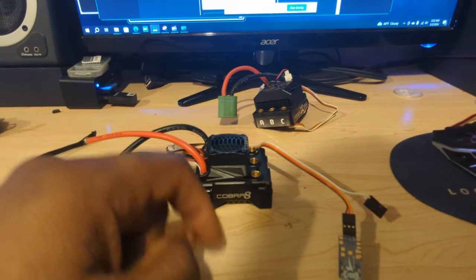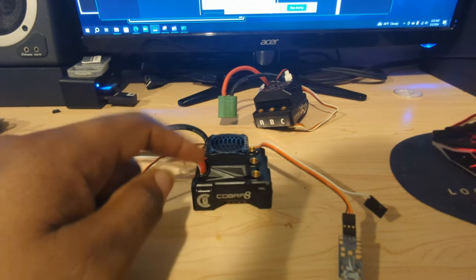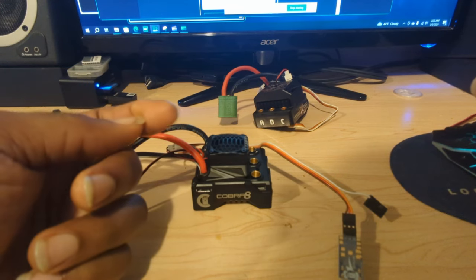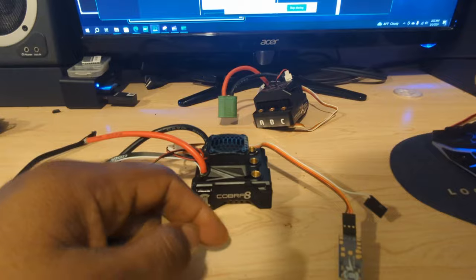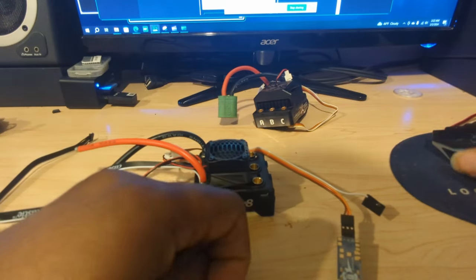If you do lap one and you're able to get, let's say, 0.6 Gs off of a turn, but then on lap two and lap three you're going slower or your G-forces are a lot lower, that's telling you that you're losing traction somehow. Or you can spot inconsistencies. So there's a lot of potential in how you can use that data. This is pretty exciting.